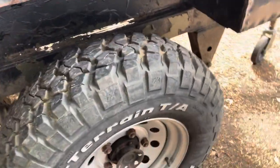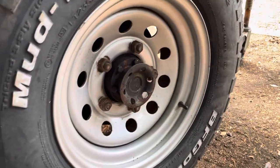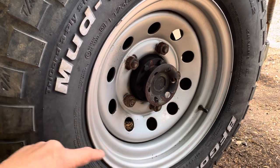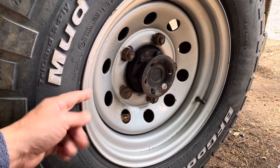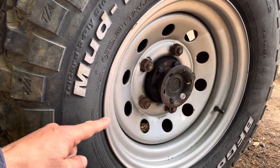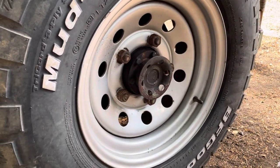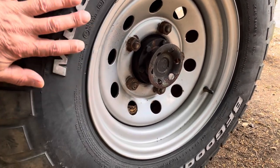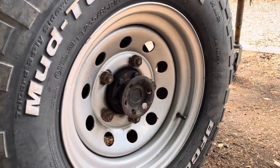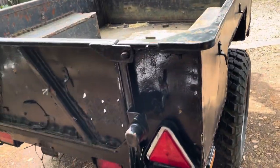We've already got the wheels — the wheels and tyres. Someone put these on at a farm; I bought this off a farmer so it's been sat on a farm for ages. The tub's rusted through on the back, so we're going to take the tub off — we don't need the tub, we just need the frame. The wheels are the right size but wrong type, because I'm putting wolf wheels on, and the tyres are 235s and I want 255s, so the tyres and wheels are wrong. I've got some refurbed genuine wolf wheels to fit. Hopefully the wheel studs are long enough — if not, we'll change the wheel studs as well. When I towed it back, it tows incredibly level — they're made for Land Rovers, they're absolutely perfect.